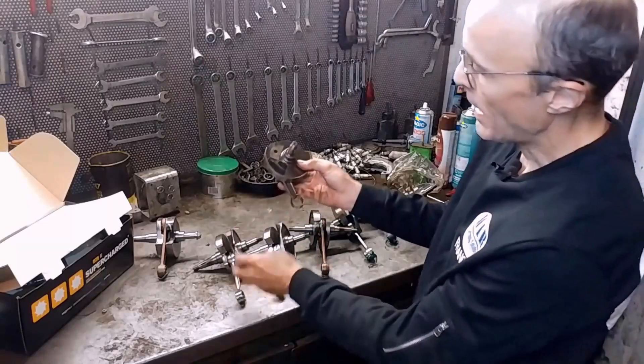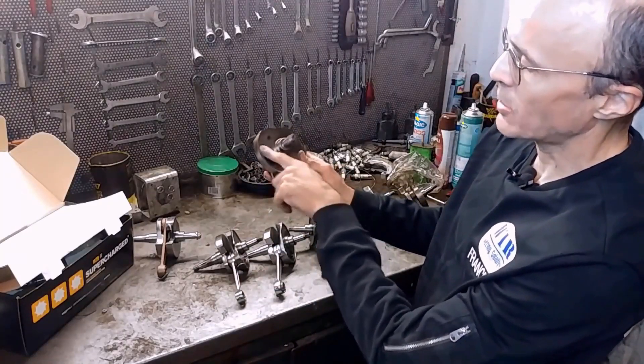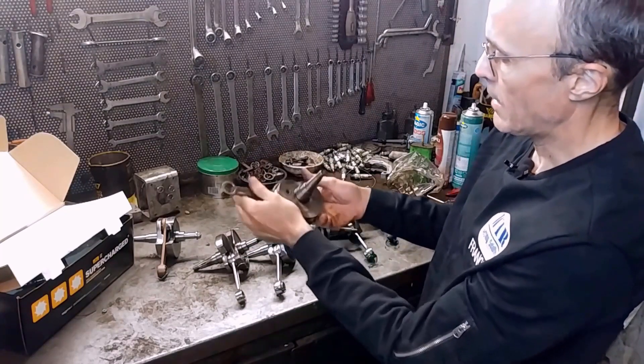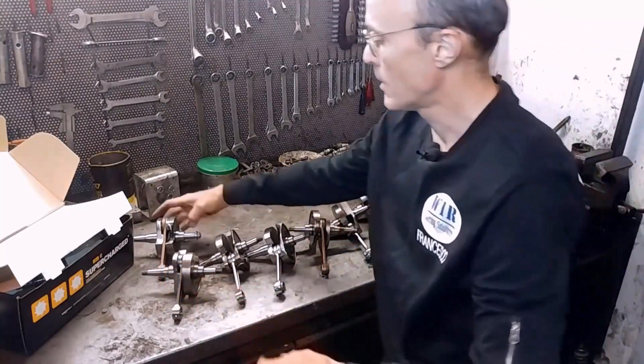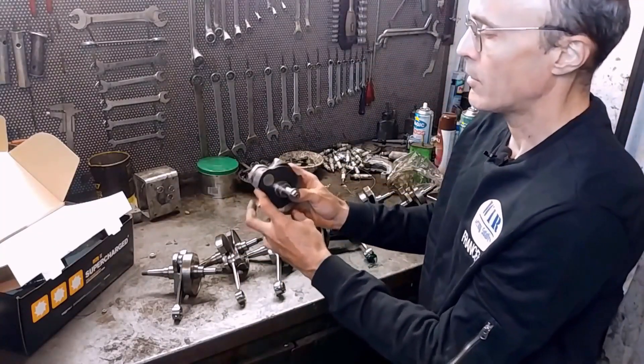The Pinasco racing shaft changes among other things because it has the original closed balancing hole, the balancing tungsten pads, even if it's not balanced at 12 o'clock. Then, just for showing, a special type of elaborated shaft for reed.